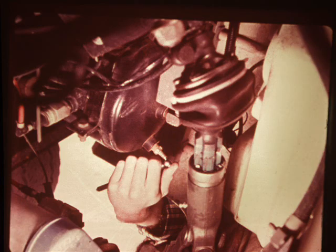Open the drain cock or Schrader valve in the air suspension reservoir and let out any moisture in the tank drain. Fill the gas tanks. This will prevent moisture from condensing on the walls and getting into the fuel system in liquid form.